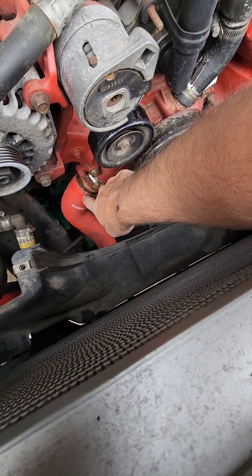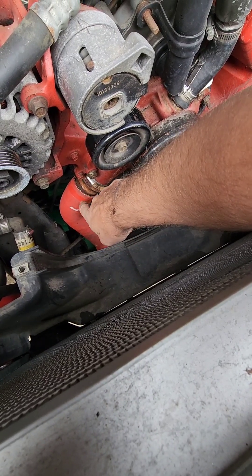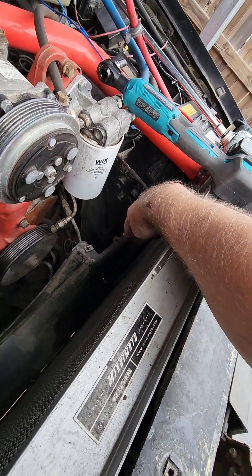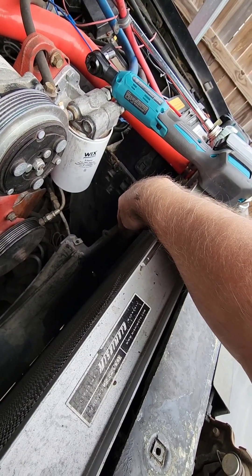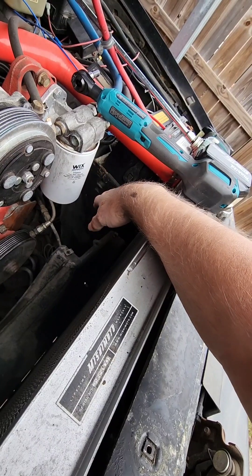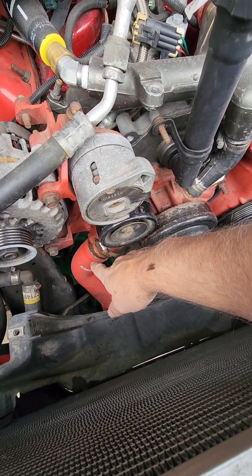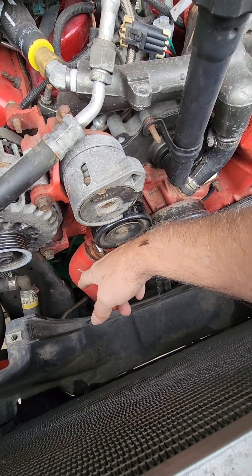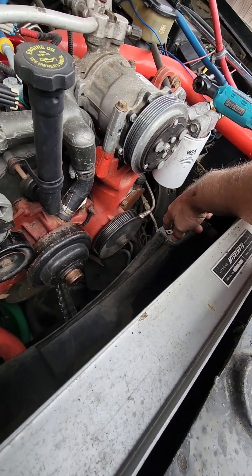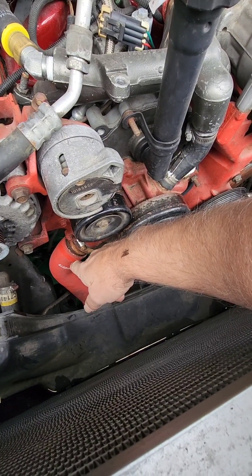I've got the hose broken loose and it's about ready to pull off. I'll open that up and everything's going to come gushing out into those buckets. Hopefully I catch all of it because I've got a couple hundred dollars worth of Evans coolant in this thing. You might ask why I don't use the drain valve — when you open that drain over there, it just goes everywhere, all down your frame, dripping everywhere. That's a terrible design. The best way I've found is to dump it right here; it comes out in such a volume that you catch the majority of it.